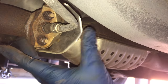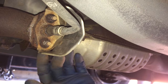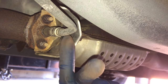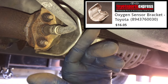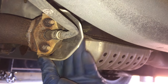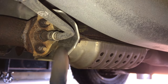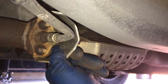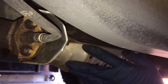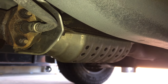Here's a look at another Toyota, same spot — that post-cat O2 sensor. I wanted to show this because I believe that 1998 RAV4 we're working on would have had this little shield on here. When those nuts and studs fell off, this shield would have fallen off too, which is why we can't see it on the current one. I'll put up this part number if you'd like to replace it. Some Toyotas have this, some don't. I'm not sure exactly how essential it is — whether it's a heat shield or a water deflector. This is also going to be missing on a lot of older Toyotas because it's aluminum but the fasteners are steel and they'll rust out.